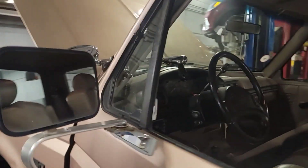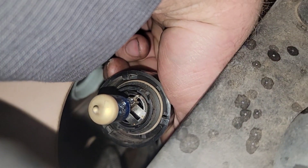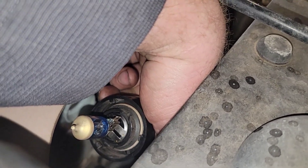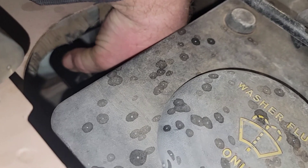The headlight issue - he had a 9000 series bulb and he tried changing it himself. He didn't have that rubber ring pushed all the way past the collar. No charge - I got him, put it in the correct way. It snaps in now. As you can see, I'm pulling on it and it's not coming out of there.